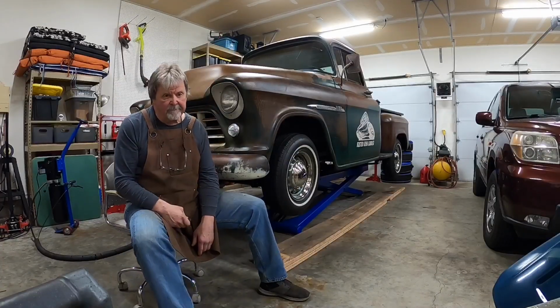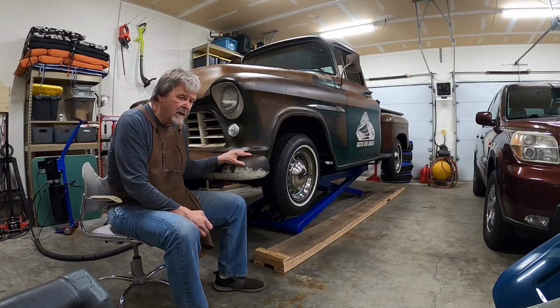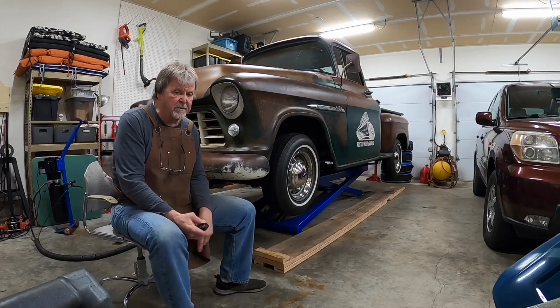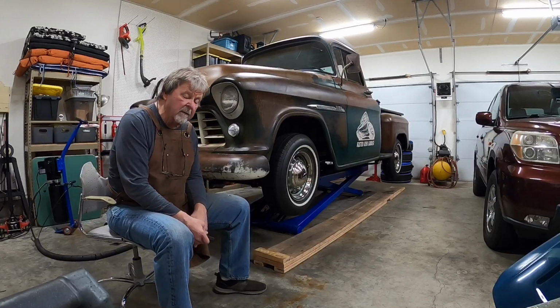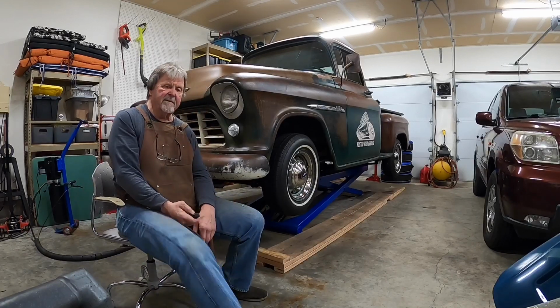Well, today we got the steering box adjusted on the old junker. All we have left to do is bleed the brakes, and then we can take this out and see how it drives with those shims in it. I think the front end's pretty much aligned, about an 1/8 inch toe in. So we'll get the brakes bled and get out and do that. Although it isn't going to be today for 2 reasons. 1, I don't feel like bleeding them right now, and 2, it's raining.